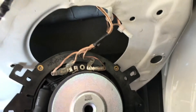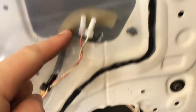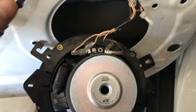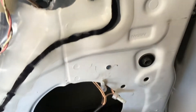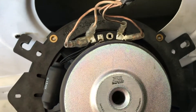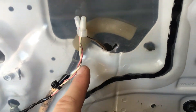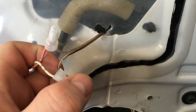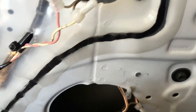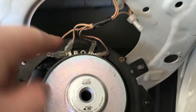I got the woofer out for you. You would see a harness that plugs into the back of the factory speaker — you undo that. This is where the harness would be, because it just plugs into the speaker. Unplug it and you'll have these wiring colors. This mid-range woofer has two sets plugged in. The main harness comes in from the radio. I've cut off the factory harness — the lighter color is the negative, and the pink color is the positive. I used crimp caps and hooked them on. This speaker wire came with our Alpine, so I didn't have to buy that separately. I attached that together and ran it back inside the door panel so it plugs directly in.